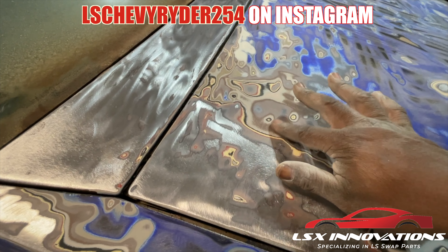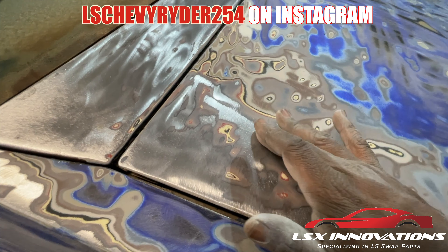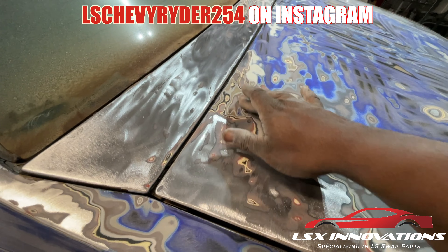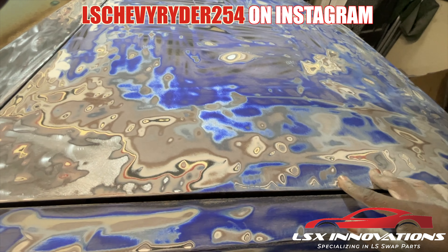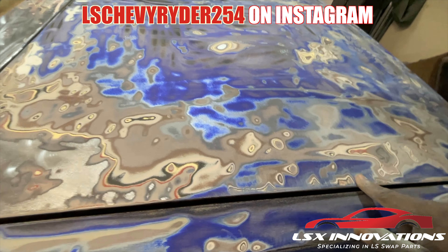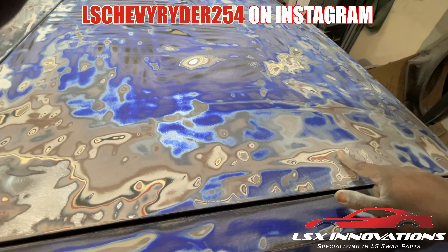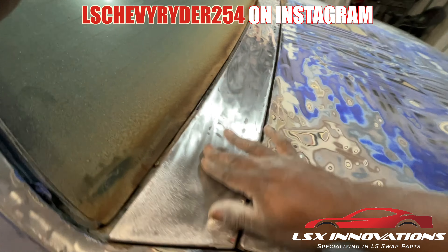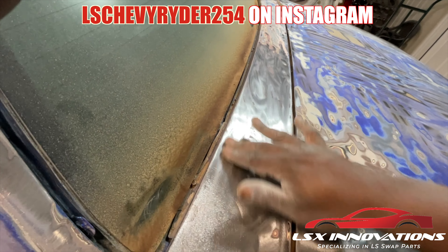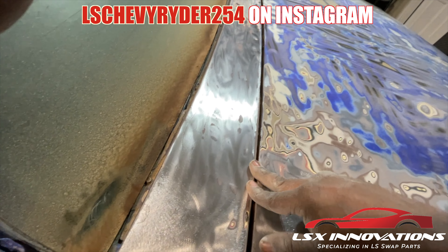Unless you just want to strip your whole car all the way down, that's perfectly fine too — but this is looking like a Picasso because of all the different colors and layers that were on here over time. On the trunk I pretty much have to commit to bare metal, because if not then what I'm gonna have is unevenness or waviness. Let me know, paint people — do I have to commit or can some high-build primer get me out of this jam?